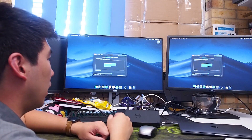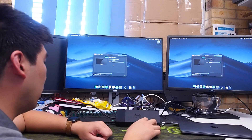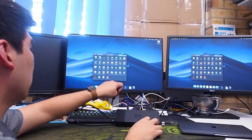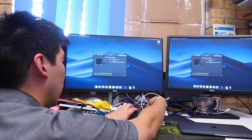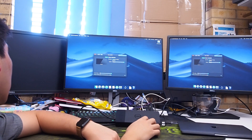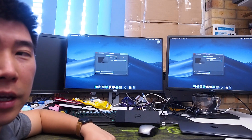Let me try closing the MacBook lid so it runs only on external screens, and then put all three monitors back in. Unfortunately it's basically just mirroring — it won't extend itself. With three monitors reconnected, the third monitor only shows a power-saving mode message. So it's incapable of driving three screens with the MacBook Pro and the WD-19 TB. Hopefully we'll get some new DisplayLink drivers that fix this — fingers crossed.